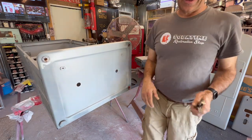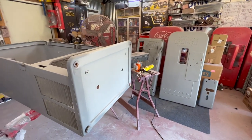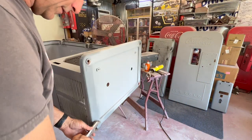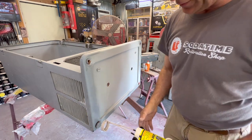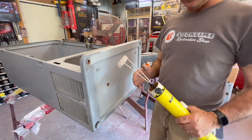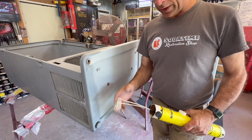All right, let's go to this last one. This one here, I've already checked. It's going to be the one that we're going to have to do a different process on. This is called a mini ductor, and what this does is put an electrical field all the way around that bolt head. One thing I like about these mini ductors: no flame, it's just direct electrical heat.